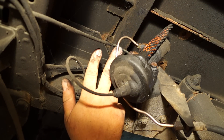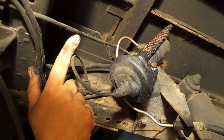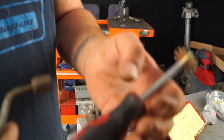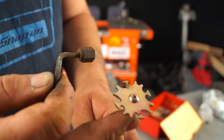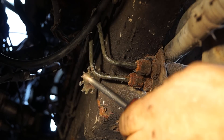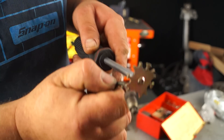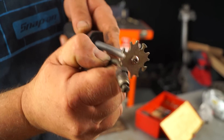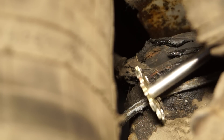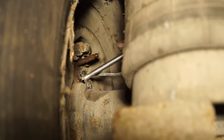Where I'm pointing at now is another brake pipe that's been covered with body wax, which is quite good for preserving. However, what needs to be done quite often is check for corrosion. Now I have a scraper tool here which is from Sealy Tools — it has a very odd head on it. This is for scraping, getting round corners, and taking the grot off so you can see where the corrosion is. It will scrape a pipe very easily and it's a very effective tool, especially for MOT preparations or even just for servicing, checking for corrosion as you can see here. It's a useful corrosion assessment tool — you can get into very tight places, reach in, and scrape the grot off so you can inspect your pipes before an MOT.